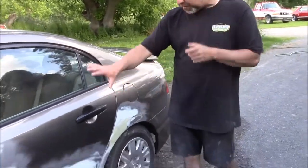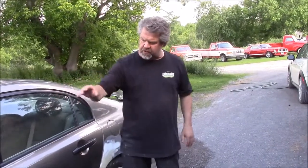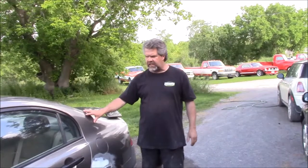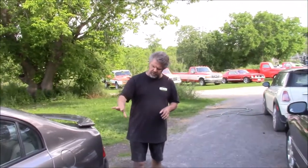So basically what we did is we did a proper repair on it. We've got the body smoother all blocked out, and then later we're going to spot prime that, so it'll be the same as the front fender. The neat thing about this dip product is it's a rubberized base, and with this car we're going to do probably about 4 or 5 coats of a black coating as the base. Once we spray that, it's going to bond to everything on this car. The most important thing is it has to be clean. So we've got the car all nice and clean. We've done the appropriate repairs. Then our next step is we're going to make sure everything is nice and clean, and we'll start masking the car.